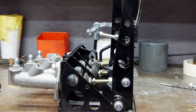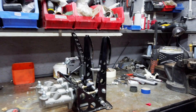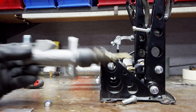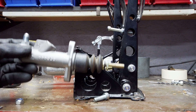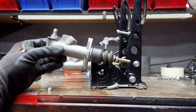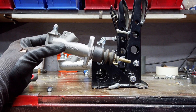Here's a standard pedal box I have from OBP. As you can see the master cylinders are there at the back. As it is, it's not going to fit in the Clio because the pedals will be too close to the driver. What I'm planning to do is modify it so each cylinder, instead of sitting like that, can sit at a slight angle like this. I'll be moving it about 20-30mm up and about 10mm out so the angle stays the same with the shaft, and hopefully this will give me enough clearance over the firewall.